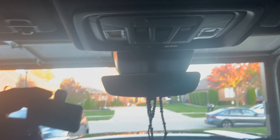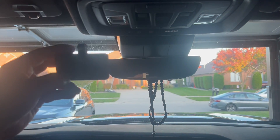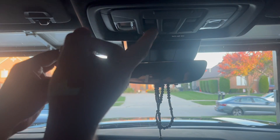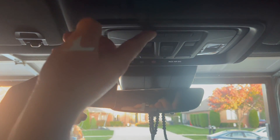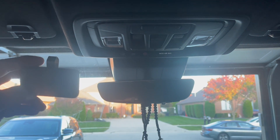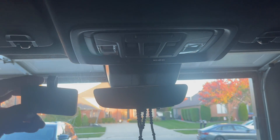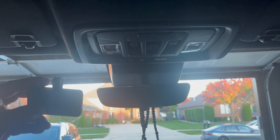So what's going to happen right now is we're going to press and hold both the remote garage door opener and your truck button over here, and you're going to watch the light. That light is going to start blinking slow, and when you see it start blinking fast, this means the button is programmed, and then we're going to release it.